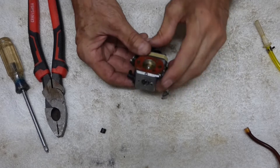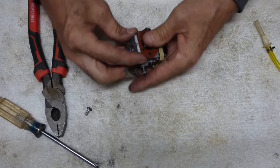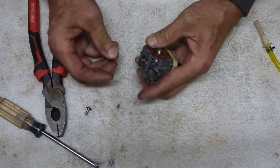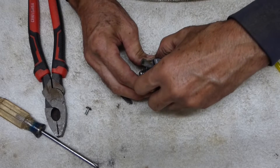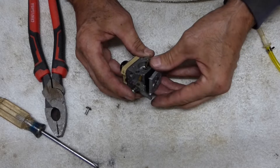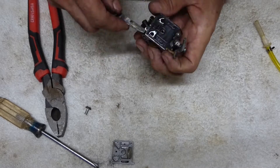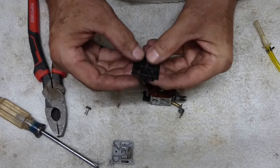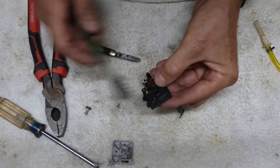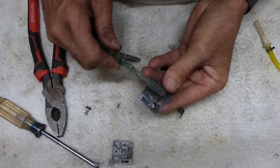Let's take this carburetor apart real quick, just clean it up and put it back together. You want to be careful taking these apart — if you're not putting a gasket kit in it, you don't want to tear the diaphragm. The diaphragm in this carburetor might be stiff and then we'd have to get a rebuild kit or a different carburetor. It's actually in good shape — amazing. I like to be careful about spraying these with carb cleaner, especially the rubber parts — it can really warp them. So I'm just going to brush this off.